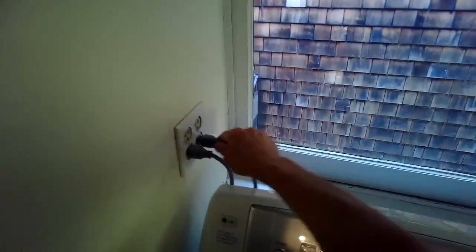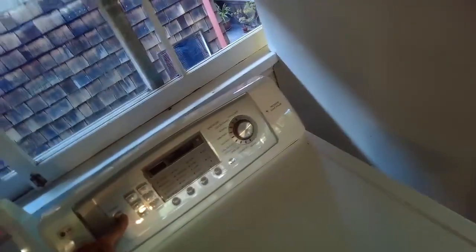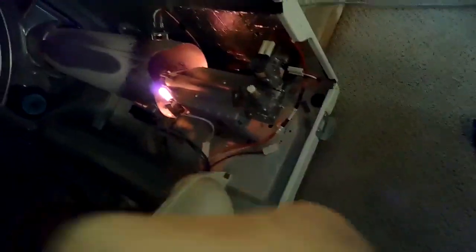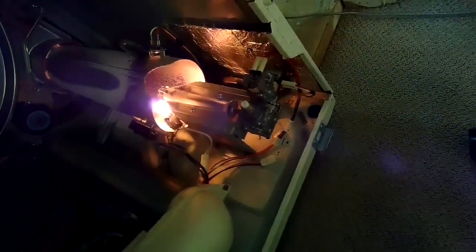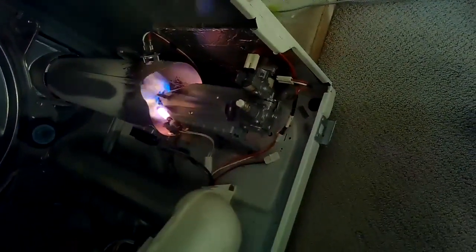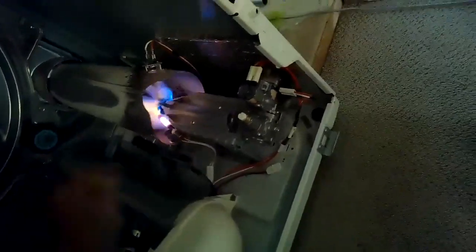Good on our lines. We're going to take it for a test drive and see if the gas valve opens up. I'm going to turn on the gas, turn on the power, see what we got, get the lines hooked up, start it. I'll watch for a glow and see if it's going to let the gas in. There's our glow — so when it gets hot enough it should open up this valve and let gas flow in and ignite it. Let's see what happens — hey hey, got gas! There we go, yeah! Cool, back in business.